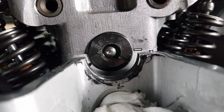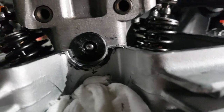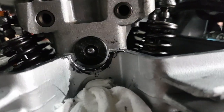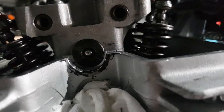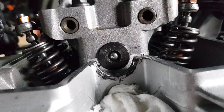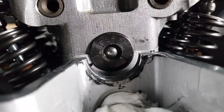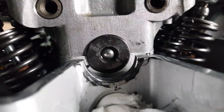The recommended way to turn the camshaft to top dead center position would be to remove the little access port and turn the crankshaft — we did not have a 14mm hex on hand. There has also been some confusion and contradictions regarding which way to turn the crank, so we decided to employ something a little more old school. What is the camshaft — and ultimately the crankshaft — connected to? That's right, the rear wheel. So we decided to just spin the rear wheel to get the camshaft to top dead center position.